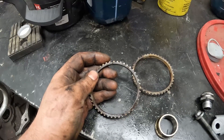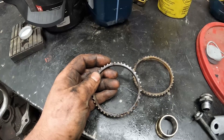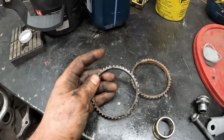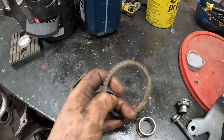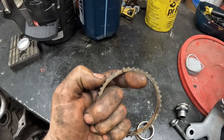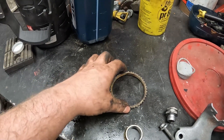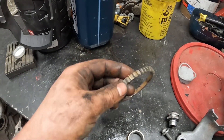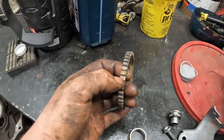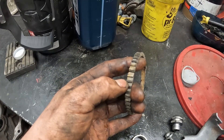So these can be kind of tricky. But if you have a Ford product — an Escape, Explorer, a whole lot of that sort of stuff, mid-2000s, late-2000s, early-2000s — and you see the rings are on the axle and not part of the hub bearing assembly, give them a look all around. You can grab them and see if you can spin them, but usually if you look carefully you'll see the split. Usually what you'll see is one spot between the tones that just looks a little wider apart.